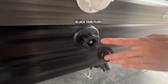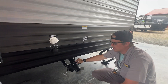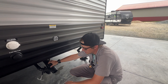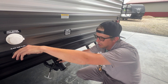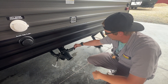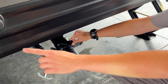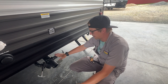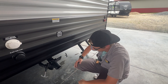This black valve here is your black tank flush valve. If you hook your hose and regulator up to it — I recommend the regulator because if not, the PSI from the hose can pop your lines — this spins small aerators on the bottom of your black tank that will clean the gunk off the edges and bottom. In order for this to operate properly, you're going to want your black tank valve open — you'll see the metal rod, which means the black tank is open. You never want to use your black tank flush if the black tank is full and the valve is closed. Always make sure the black tank is empty and the valve is open before you run your black tank flush.